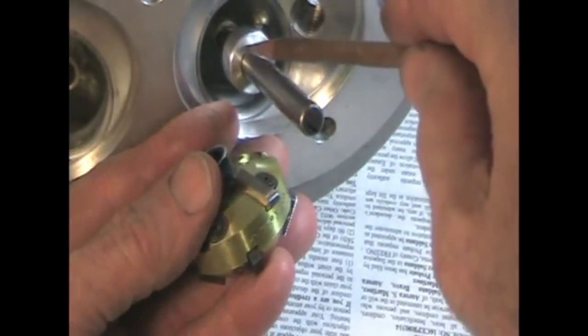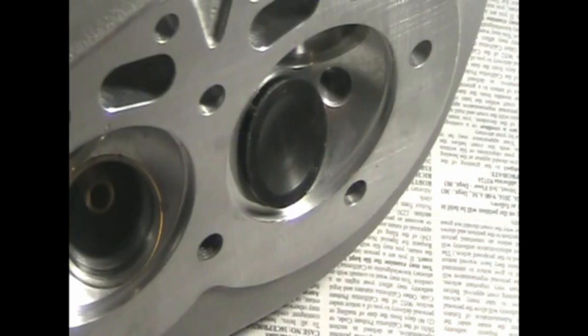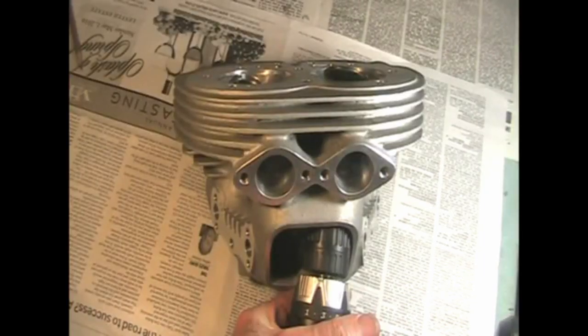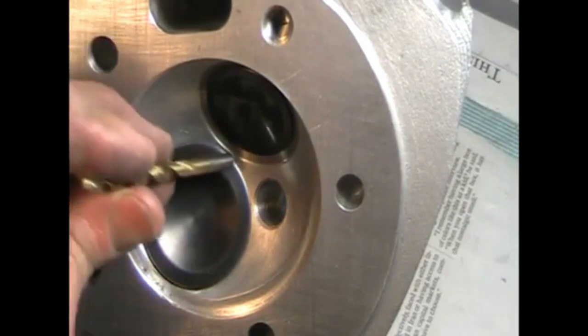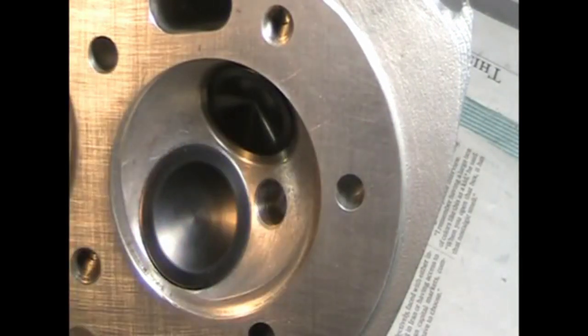But then you'll need a collar for the pilot so you can carefully control the depth of the cut. Use fine valve grinding compound and lap the seats to make sure you've got a good seal. Lapping goes a lot quicker if you grab the end of the valve with a drill. Once you're finished lapping, you can use the butt end of a drill bit to check the clearance between the valves to prevent valve clash.